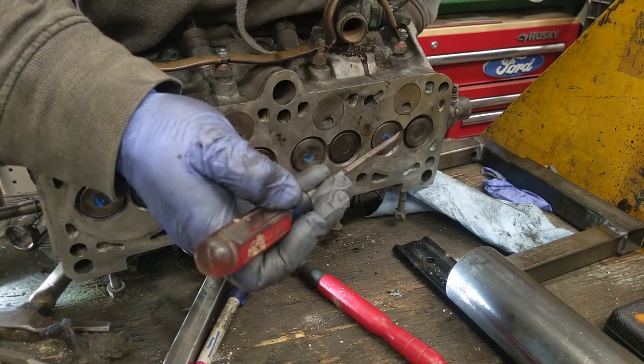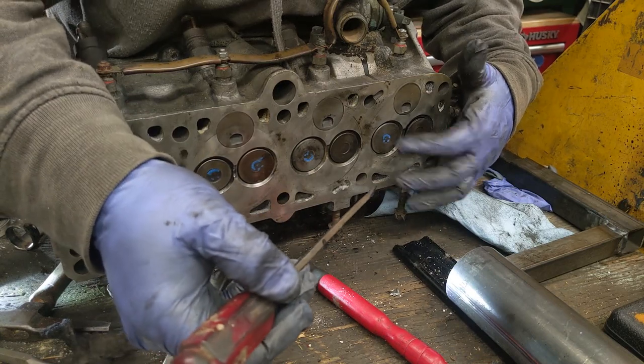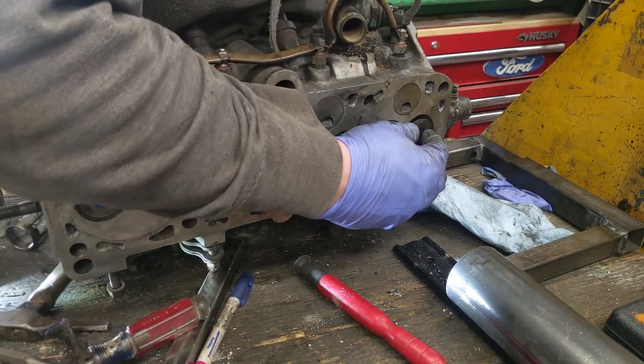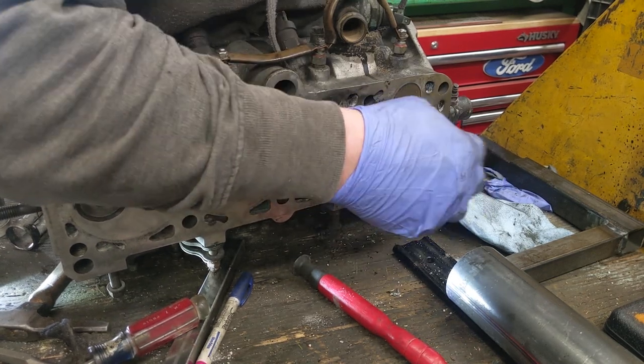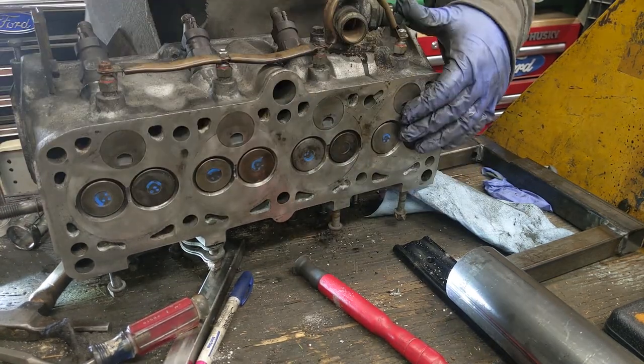And you can actually get a screwdriver in there and just pry it over. Try not to damage the seat. Shouldn't, though. It's really hard. And usually you have to bend it a little bit more than you want. Check again. Take it out, put a straight edge on the shaft, see where it's bent at. But generally, you can get it. A little bit of finagling.